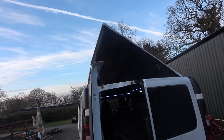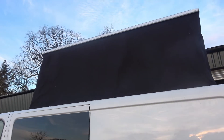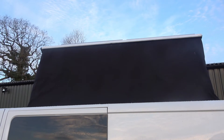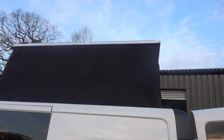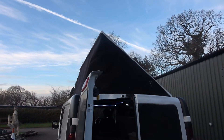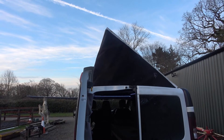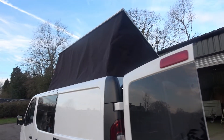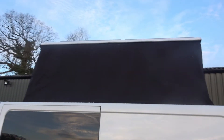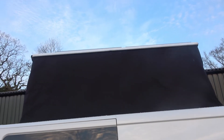The aluminium is good because it was relatively easy to work with and it's lightweight, but you have to really account for condensation dripping off any uncovered areas. The carpet does a good job of stopping condensation, but honestly I'd consider making it out of wood — it's much easier to work with as long as you coat it properly, and it would be a lot warmer and nicer. The aluminium framing took so long because there were hundreds of rivets, and it's much more difficult to cut and attach things compared to wood.